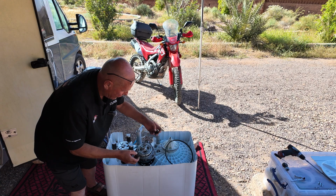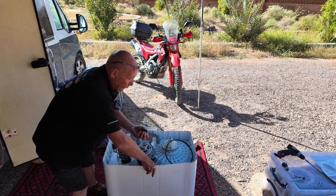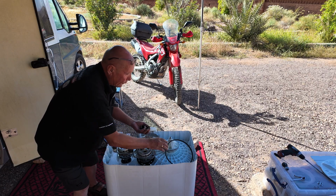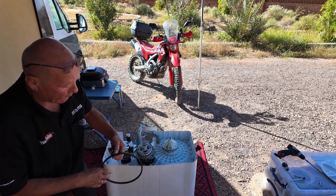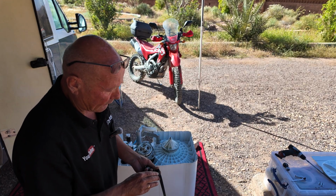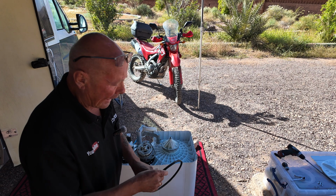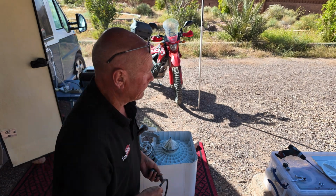This is the spin motor, and we also have the bolts that drop down, and also the belt. Just for reference, the belt on this machine is an 0670F, and that is usually the length of the belt and the design of the pitch.